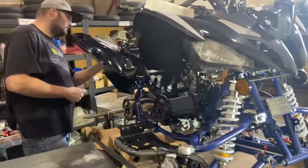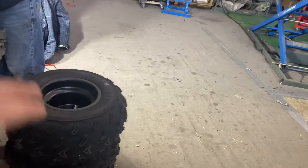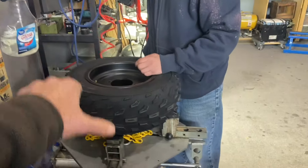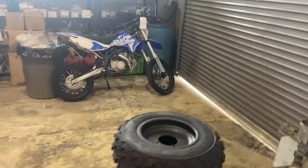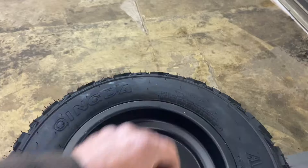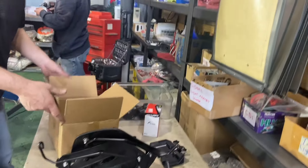The bike is a bit naked now — they removed all the hardware, parts, and wheels. What Marcus is doing right now is seating the bead on the tires, because they do arrive flat, so you have to put the proper air pressure in. Also, sometimes you have to tighten up the valve stem inside — those are not always tightened and air can come out. Tire pressure is 5 PSI on the Pintura 150, as marked on the sidewalls.